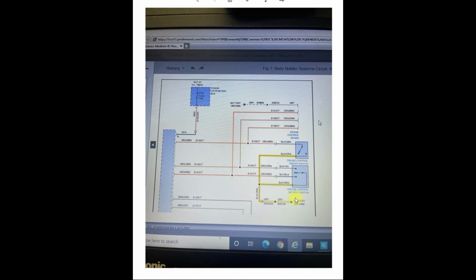Simple as that. So we're going to create one wire coming off the plug that's going to spider out into two, and you'll have a ground going to each switch, and then the other three will connect individually to their proper locations. I'm going to also attach, if I can, a link to this diagram for those who need it in the comments, or just simply paste it in the end of the video for everyone. That's what we're going to be recreating with the wiring, is what we'll step into next.